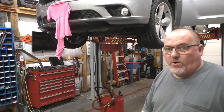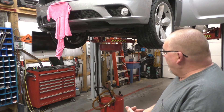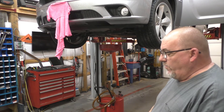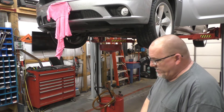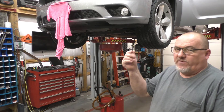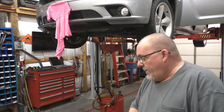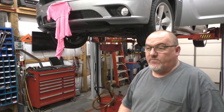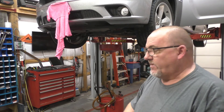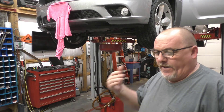We're going to do an oil change. I'm not going to charge the customer full diagnostics since I didn't do a whole lot, so we'll cut the diagnostic cost a little bit. I told the customer if the problem persists it's going to be more involved — money-wise and time-wise — because we'd have to get the intake off to get to the solenoids for the actual inspection. I suggested to the customer to start here first so we know there's good oil in it.